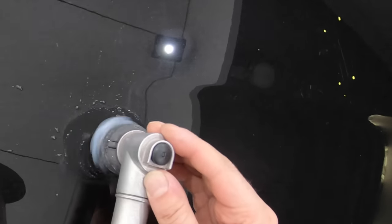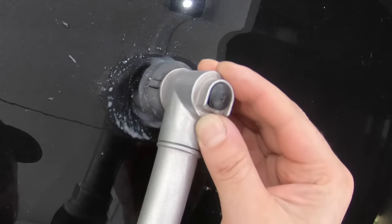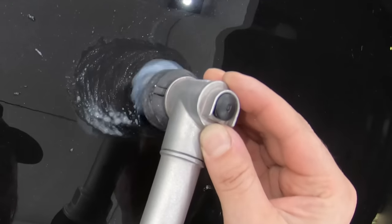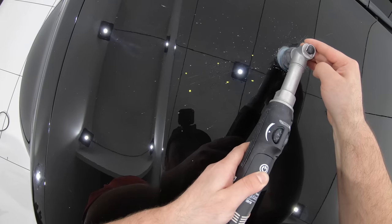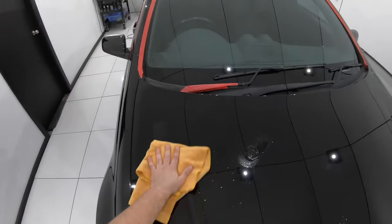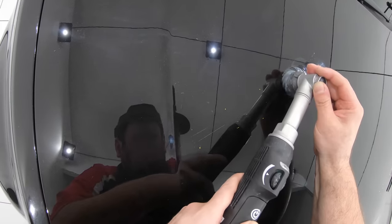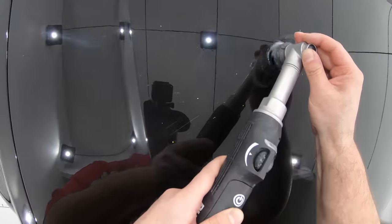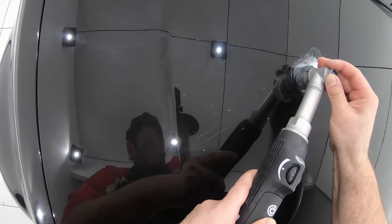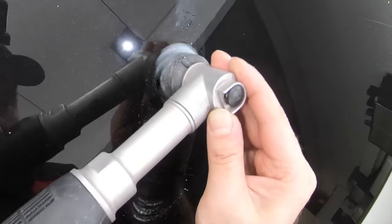If you're using, say, a cleaning chemical that's staining, hazing, or etching a car surface, or you're removing exorbitant amounts of clear coat during a paint correction process, then no, it's not safe and you need to immediately stop, reassess, and find a safer alternative. The same goes for question two, efficiency. It's fantastic if you're using a safe and effective method, but if you're spending half a day cleaning a steering wheel, it's obviously not an effective or appropriate way of proceeding. So you need to find a better way to progress more efficiently.